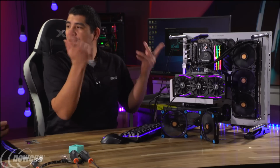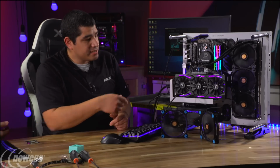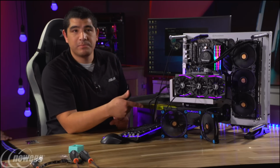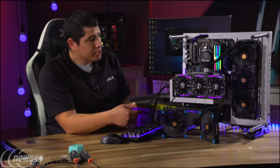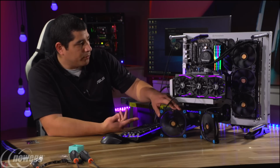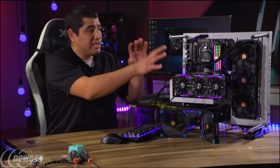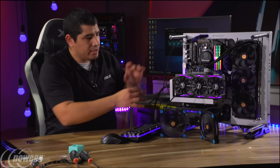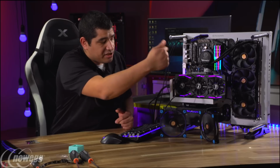Now we're not just overclocking the system, we're optimizing all the fans. So now what it's doing is running through finding out what the maximum and minimum speeds of all these fans are in real time. So I've got these add-in fans. These are the Thermaltake Ring. These are 140 millimeter fans. So these are kind of representative, like I said, of different scenarios: top fan, or maybe exhaust fan, or maybe a side fan. But what you're seeing is they're now all slowing down.